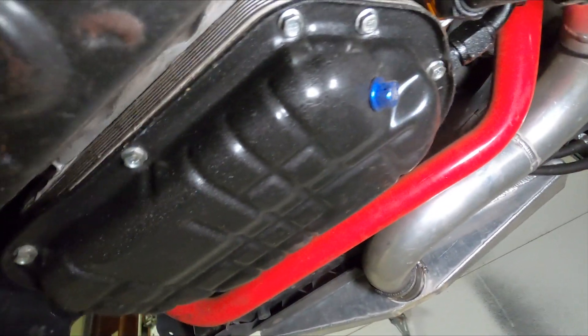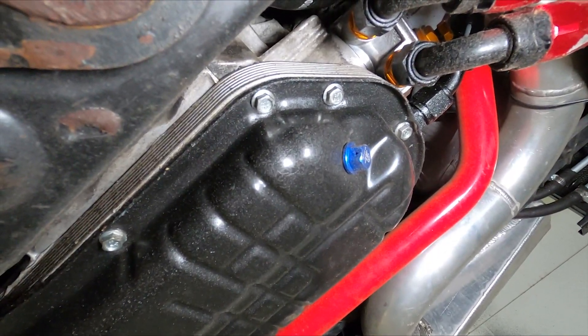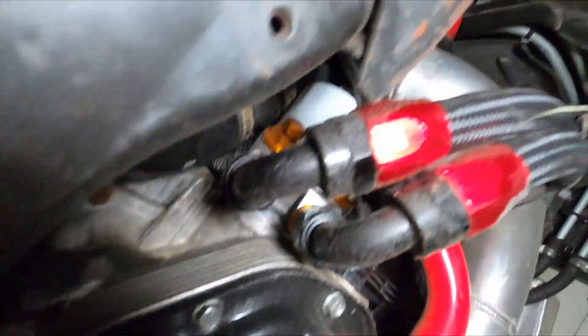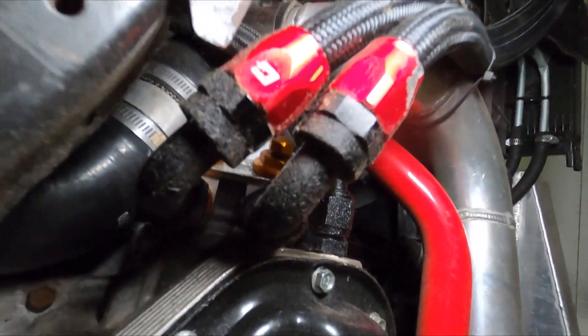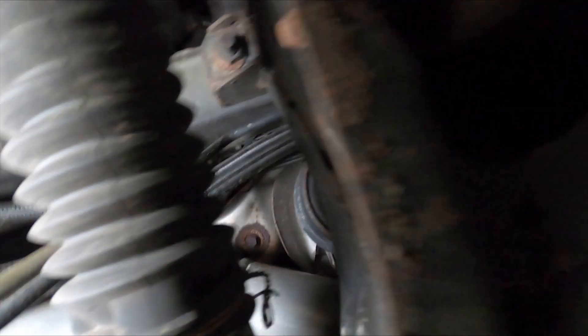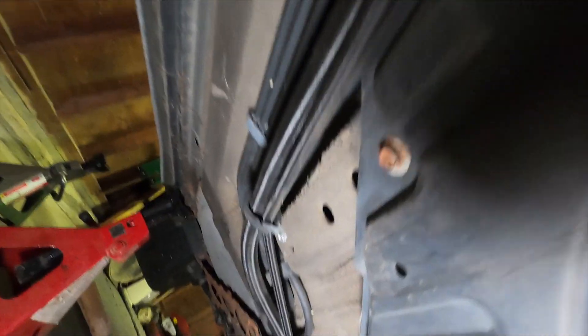I'm gonna grab my light and my GoPro. We're gonna dive under the car and I'm just gonna show you how the oiling system works and how it's routed. It's a little bit nasty under here, but here is the oil pan — the bottom of the engine. Right here is the Z1 oil pan spacer, that silver bit right there. It's a pretty easy install — basically just an extension which means you can store more oil, but it also comes pre-drilled for your AN fittings for your return and your feed line. So you get your oil from here and it gets returned from here as well. Up here there's a sandwich plate for the oil filter and the oil cooler, but we'll loop back around to that. The lines get fed up through here on the passenger side and get routed all along the passenger side of the car, pretty much following the fuel lines all the way back to the scavenge pump.